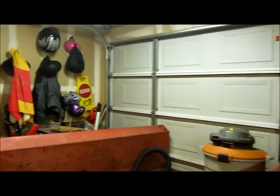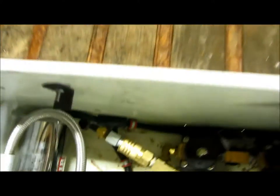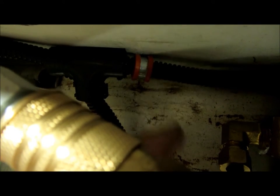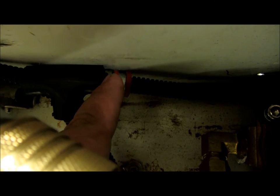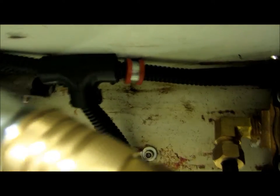So I got to step through the jungle gym here. I put one of those in — these things are pretty cool. I didn't realize that the ones for 3/8 and 1/2 inch were the same for these T's. The 3/8 grabs the outside part of this convoluted tubing, and if you use it on 1/2 inch it grabs the little valley of it, so they're the same. I figured that out, so I put one of those in there.